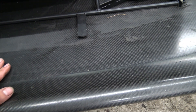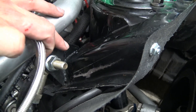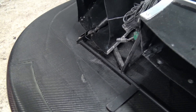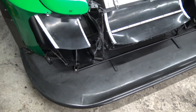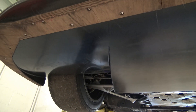I was really fortunate to get my hands on one of these. It's probably two inches thick, and inside the carbon fiber is a honeycomb aluminum core — insanely strong. It has four mounting points: one on each side and two in the rear. I had to get creative with the ducting because it has to go around a tube that mounts right to the chassis, applying direct force next to the reinforced shock tower. There's a huge airfoil underneath with two really big tunnels. It's a real pro piece — no strut rods or anything external needed. I can stand on it and jump on it and all it does is move the suspension.